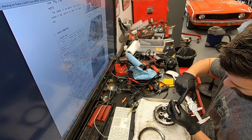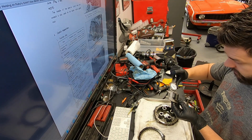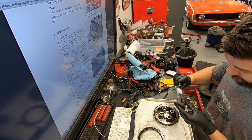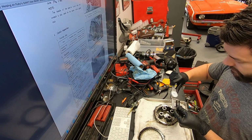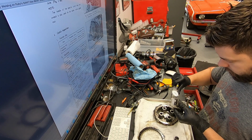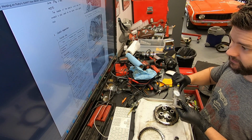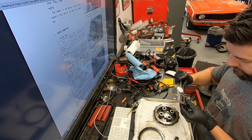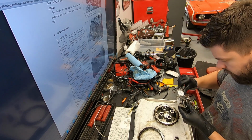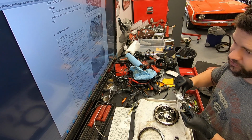Okay, you have to make sure you go across the flat and don't get stuck underneath. So we'll go right here: 1 inch, 557. And we're looking for, if it's under 555, they should be replaced. So it's close. 557, 558 on that one. This one, a little bit better actually. The same, 1 inch, 555. It is right at the limit. I might suggest, since we're in here, that we swap out to some new springs. Yeah, 1 inch, 554. So they are measuring right at the limit.